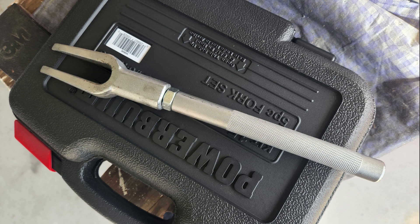The pickle fork works on the bike too, but it has pros and cons — sometimes it can scratch the frame if you're not careful, and you really have to bang on it with a hammer. I knocked on it for like five, six, ten minutes and it just wouldn't budge. My situation: this bike is from the 90s, a 25-year-old crank that had always been on the bike and must have been really tightened on.